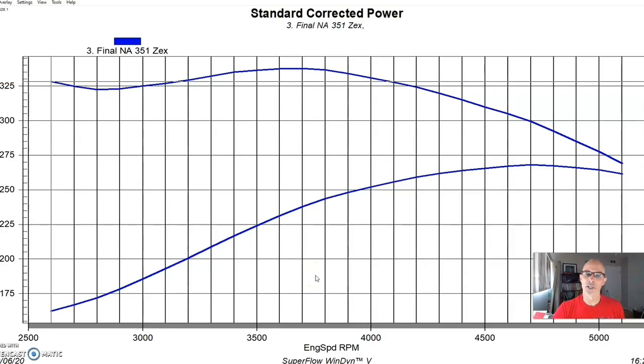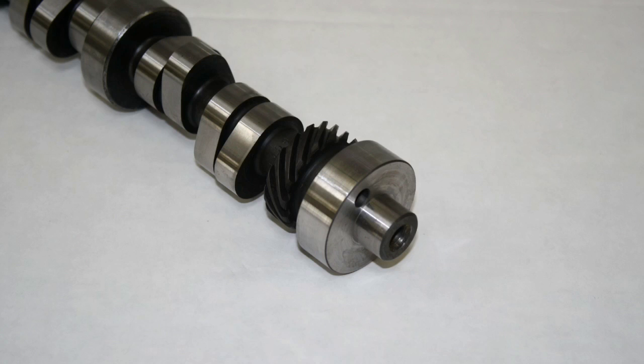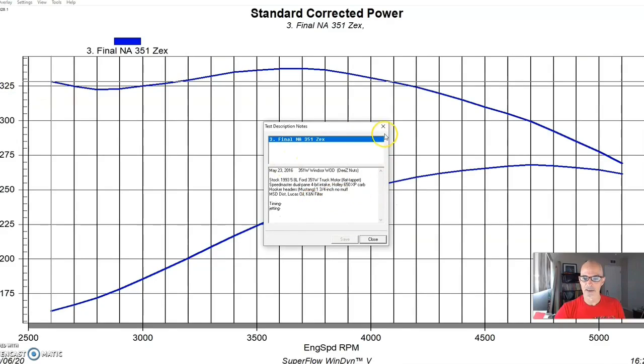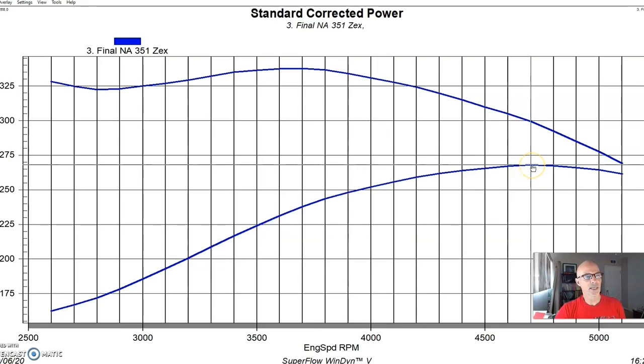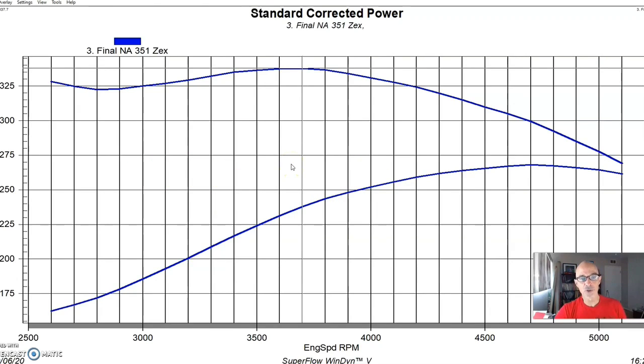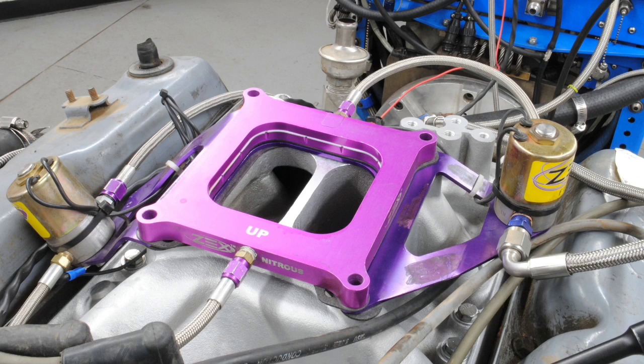To add a little variety to our 300 horsepower small block Ford combinations, I decided to show not just something with more camshaft or more cylinder head, but this was actually a 351 from the wrecking yard - also used in our 200 horsepower combination. This is a 351 Windsor, a 5.8-liter from a fuel-injected truck - an earlier version with the hydraulic flat-tappet camshaft. This combination was run with long tube headers, a dual plane intake manifold, and a four-barrel 650 Holley. It made 268 horsepower and 338 foot-pounds of torque. So how did we get it up into the 300 horsepower range?